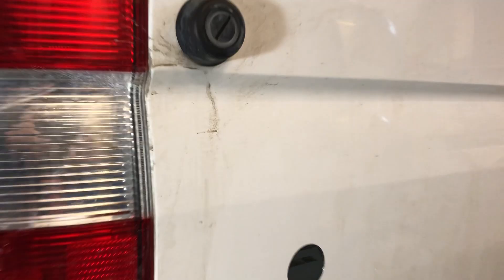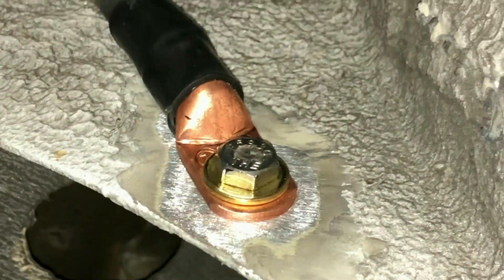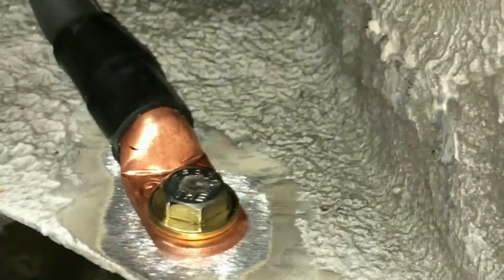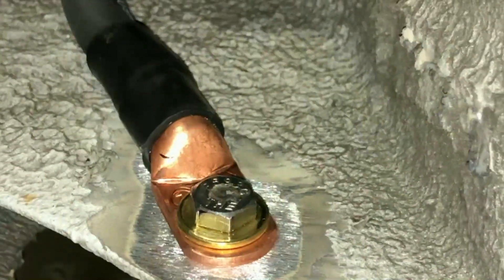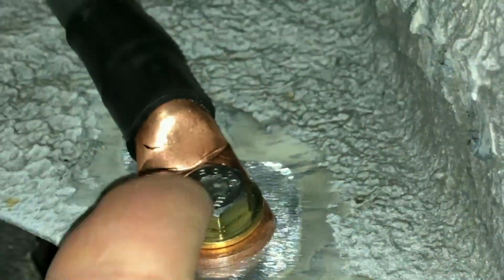You may notice there's no windows on the side of this van, so Sean cleverly added this right here — actually, that's just for shore power, he's going to be working on that later today. This is the chassis connection, which is easily overlooked in a lot of installs. We took a cable the same thickness as the alternator charger cable, because it's going to carry the same current. We ground the surface of the metal, made a solid connection, bolted the cable on there, and routed it back in and up.